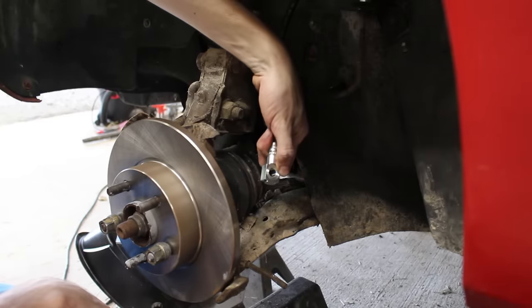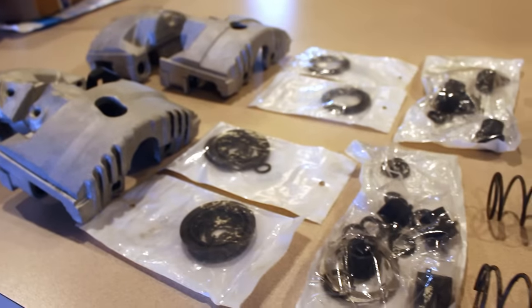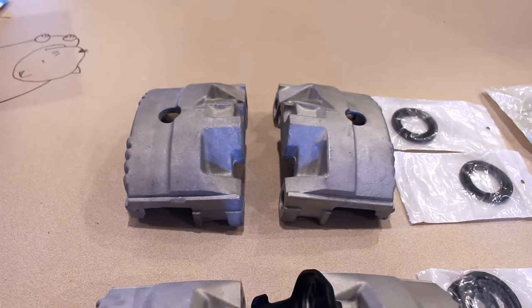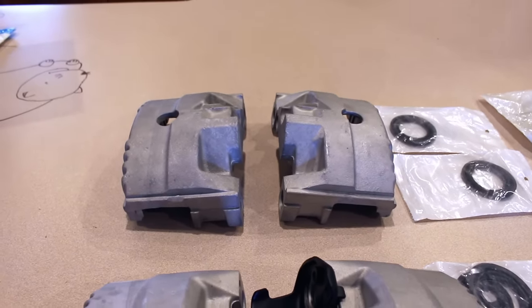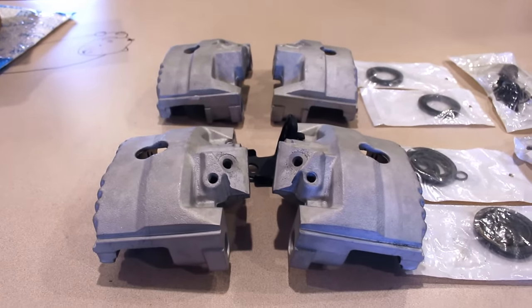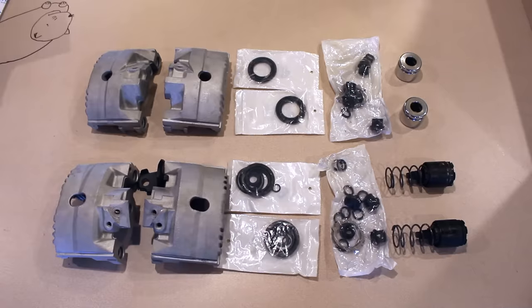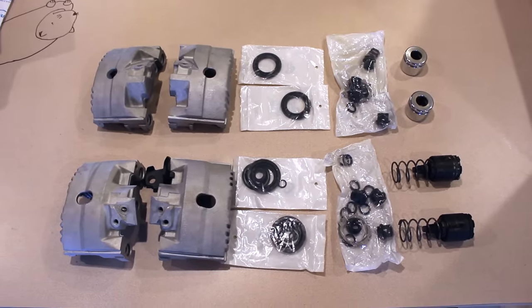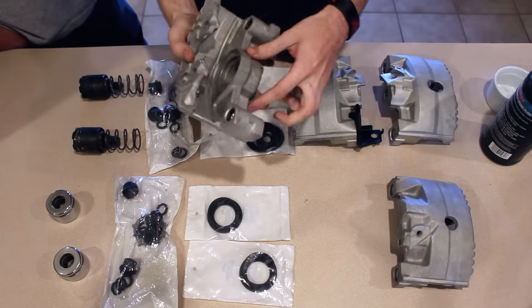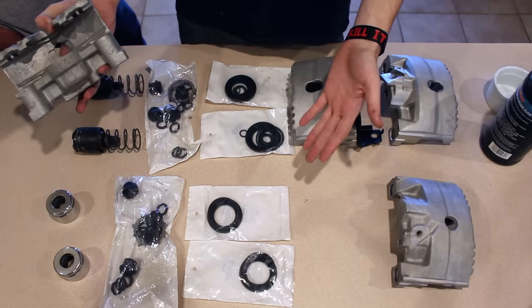With those done, the final thing to do before final assembly is rebuild those calipers. The parts, including the rotors and brake lines from earlier, were all purchased from Rock Auto and are ready to be installed. Believe it or not, these are the same calipers from earlier — my friend from work was kind enough to bead blast them for me. Thanks again, Rusty. These are aluminum, so they don't need to be painted, except for the steel bracket. The new front pistons are steel, while the rear pistons are still the originals, but all seals and rubber pieces are brand new. Off-camera, I took out all the seals, including the slide seals, as well as the square cut and dust seal that goes inside the piston on all the calipers. So now we have all the new seals ready to be put in.